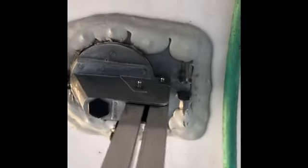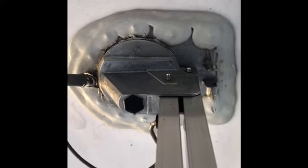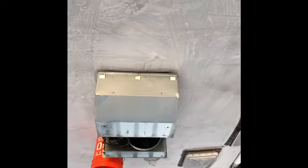I've been scrubbing and working on getting all of the surface dirt off. You want to have your caulking fairly clean going around the different parts on the trailer. My roof isn't in too bad of shape, but it is 12 years old and it's starting to get mold spots and surface cracks. That's what I'm working on — getting it repainted to avoid any future problems. That's why you've got to clean it off well before you paint it.